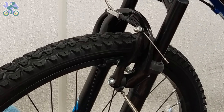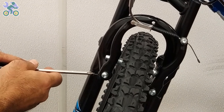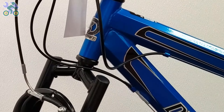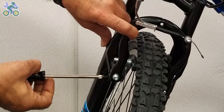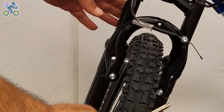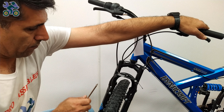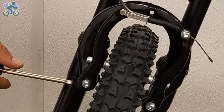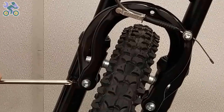If the brake arms don't move together, start by loosening the two tension screws until they're completely loose but still holding in place. Push back the arm that wasn't moving and tighten the tension screw until a little before the end. Hold and release the brake lever while loosening the tension screw by half a turn. Repeat this process of holding and releasing the brake and loosening the tension screw until both arms move together.